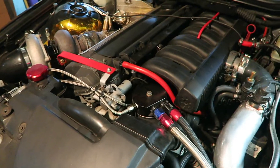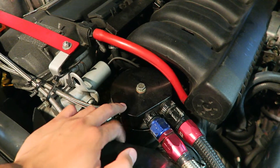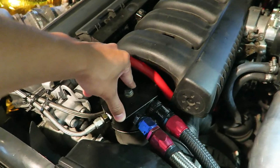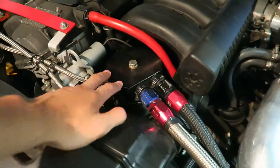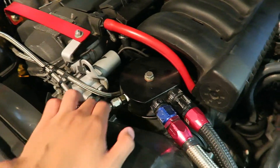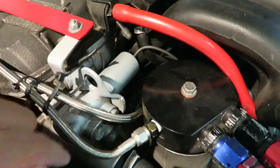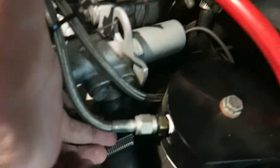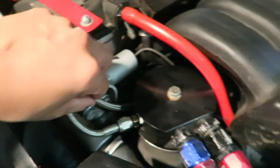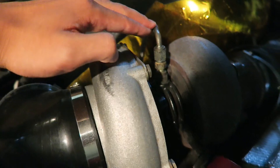Now that we're in my garage, the lubrication system for my turbocharger is fairly simple. Besides my turbo, I also want to mention this oil cap right here — the Ireland Engineering Oil Adapter Cap. It replaces the stock cap on top of the oil filter and allows the oil system to be spliced out to an oil cooler. It has two additional ports that you can feed to the turbo, but I blocked the second one and only used one for an oil pressure gauge. From the bottom of the Vanos, there's a tap bolt similar to the top bolt at the bottom of the Vanos supply oil line. That has a 6AN fitting that goes to a line, and that line goes to the top of my turbo.